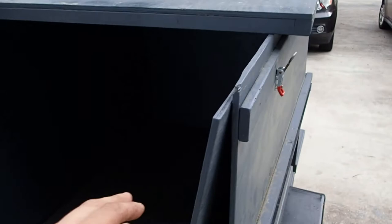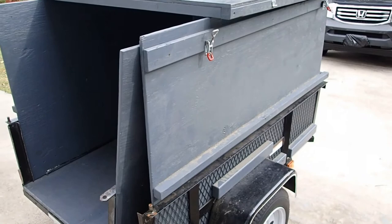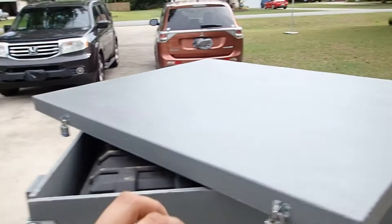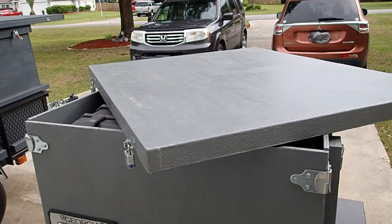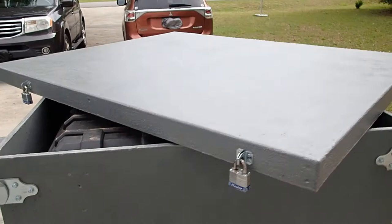The next thing is the wood. This trailer I used standard plain old plywood — added a plywood floor on top of the mesh. Weight ended up being an issue, especially with the lid. I hated how heavy and bulky the lid was at that size and thickness. For the Harbor Freight trailer, I went with super thin plywood. It has a little bit of flex, but it makes it so much lighter weight. The smaller trailer size means lighter weight and much easier to deal with, especially if you've got back issues or not the greatest arm strength.